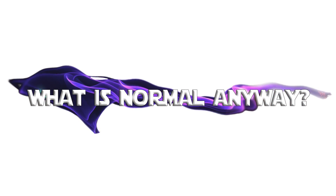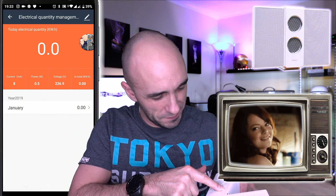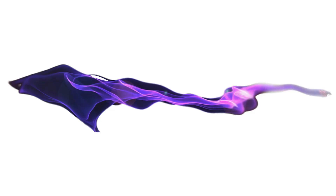Let's find out how much money I'm wasting. Dumb — not dumb as in idiotic, dumb as in not smart. The reason I'm starting with this set of speakers is because I want to get a baseline as to what something should cost electricity-wise if it isn't full of smart capabilities and Google Home-ness. 0.6 of a watt — very low, that's good. Let's switch it on and see if it makes any difference. At about kitchen listening volume we're at 1.7 watts — okay, so 1.7 watts, we have a baseline.